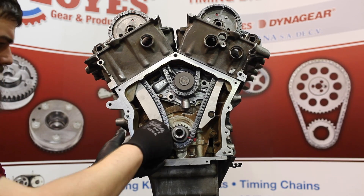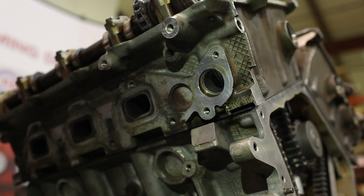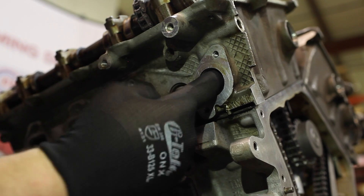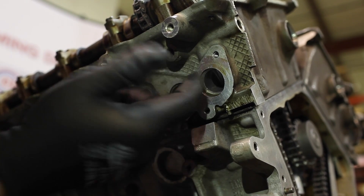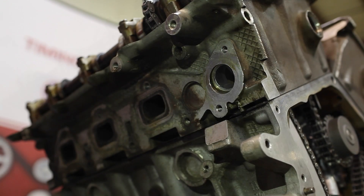Next install the primary tensioner guide and torque the bolts once again to 250 inch pounds. Before you install the tensioner, inspection of the tensioner bore feature in the head is necessary. The tensioner utilizes an o-ring for oil sealing and a retaining ring that seats on a chamfered head feature. The movement of this tensioner during operation can cause burrs to form in various locations in the bore feature. Complete inspection and deburring is critical so that the new tensioner o-ring is not damaged during installation. Also take note that the main feed inlet port at the top of the bore feature is burr free. If any burr removal is necessary, ensure that the debris does not fall into the engine and clean the tensioner bore before installation.